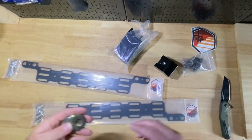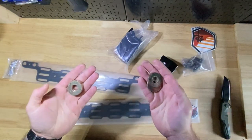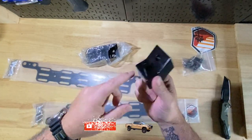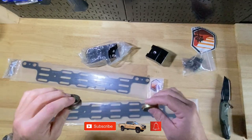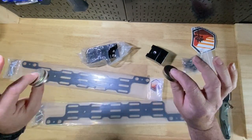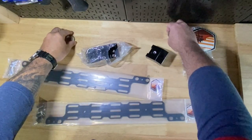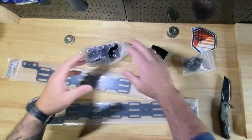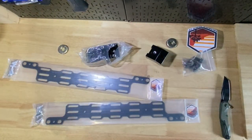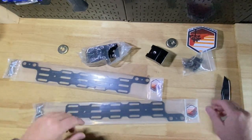They also sell spots for the back seat. I didn't want to buy their kits for the back seat — you can just go to any hardware store and pick up some washers. I would not use washers for the front though; you want a piece with a pin so it gets into where it's supposed to be. For the rear I just got quarter-inch Grade 8 washers. You might not find these at big box stores, but at your little hardware stores — the ones with aisles of stuff you'd never need — that's where you find these.